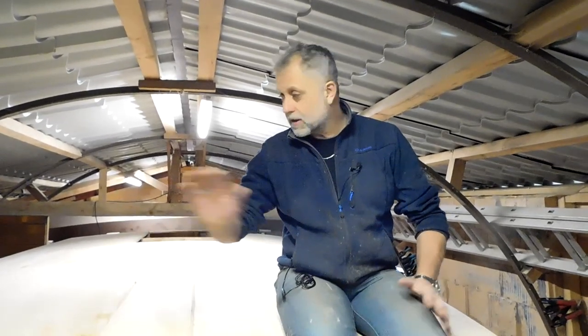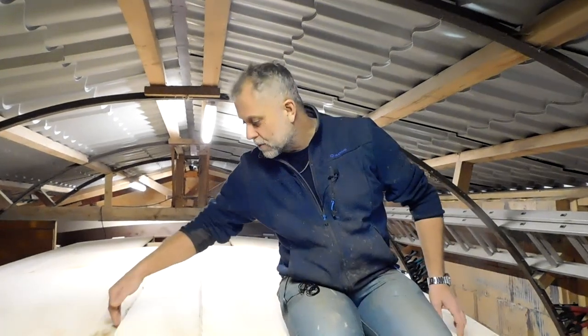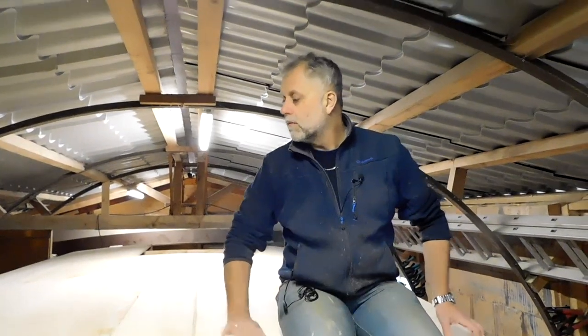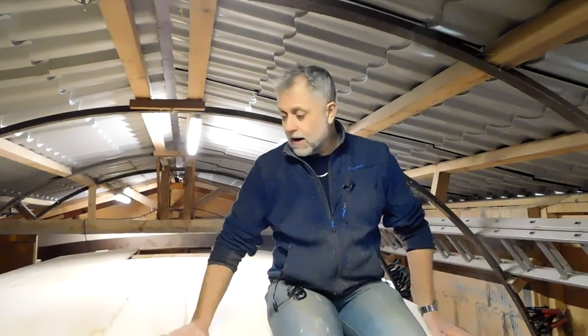So what will happen next is that I'll mix up a bit of epoxy and I shall put a coat over this entire main deck and with a brush work it into those grooves. So that's all sealed. First coat of sealing on the boards themselves. The boards will take two coats of epoxy to seal them as I've done everywhere else.